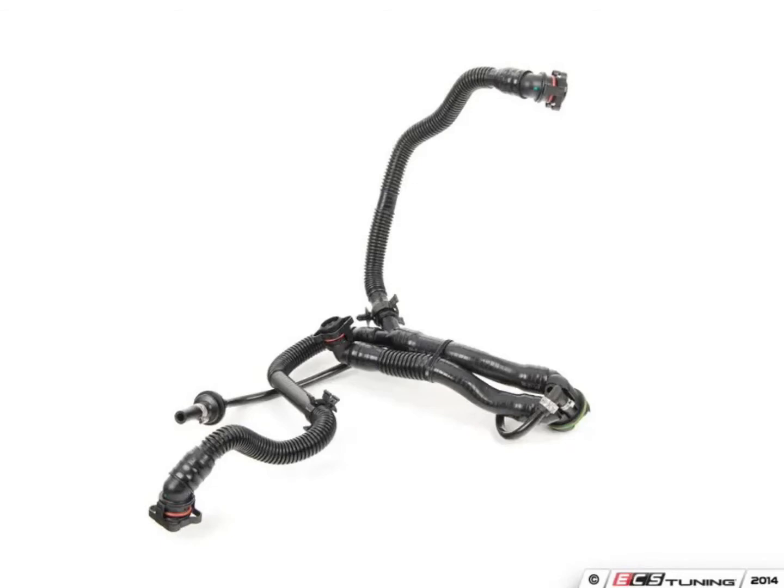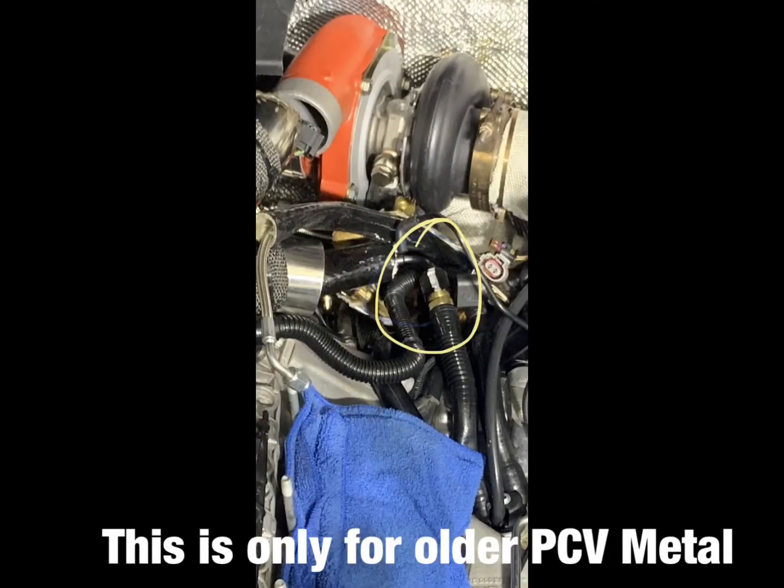I have a picture of the fitting. What I used is an EVAP plastic hose female piece, and I glued a 10AN fitting into it. I used a brass piece — a half-inch thread with JB Weld to the plastic — and put a 10AN 90-degree on it. So one side is a half-inch thread and the other side is a 10AN fitting.